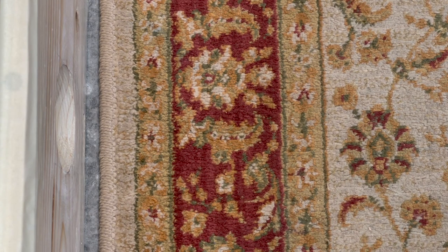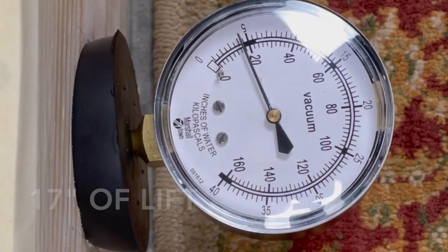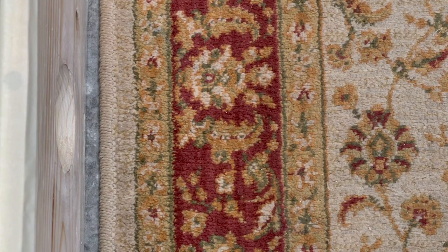So now let's go ahead and see on carpet slash low pile mode. Should increase, but by how much? Let's go ahead and see. I saw about 18 inches of lift, so it is increasing here, about an 8 inches of lift increase compared to our previous measurement. And then for our final nozzle suction test, let's do the hard floor mode,